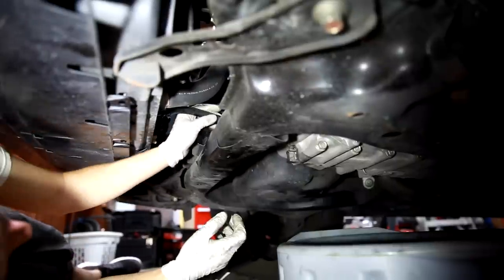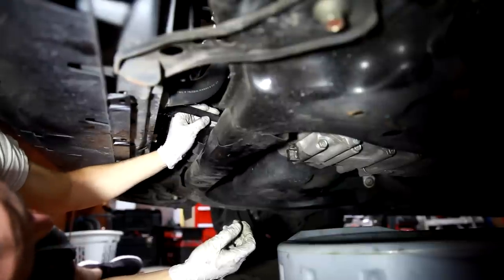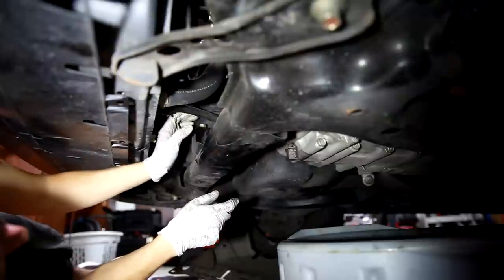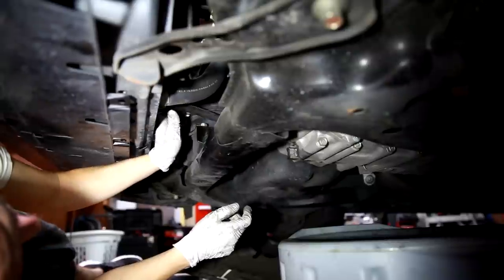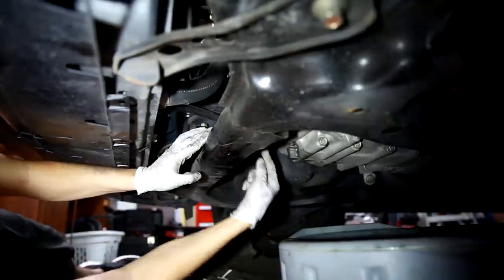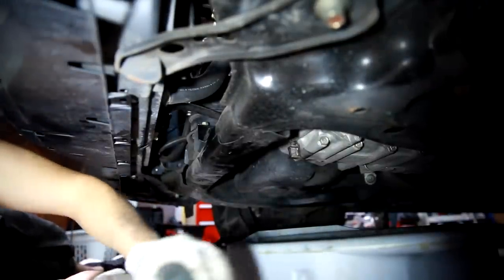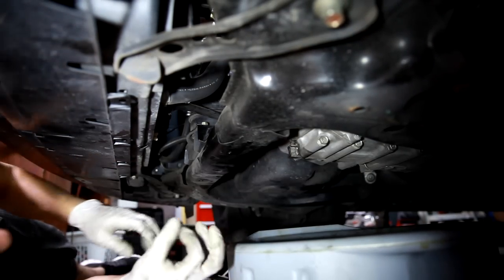Okay, so now we are underneath the car, and this line is the one we're going to disconnect, this rubber hose that goes into the bottom of the radiator for the cooler. What we found is that on the driver's side here, there's one that's closer to the passenger side, this one's on the driver's side. We're going to disconnect it and then unclip it from the little support bracket, and then you can run the hose behind this frame and down into a pan. So in this particular case, you don't need any extra hose to run a line into the oil pan.